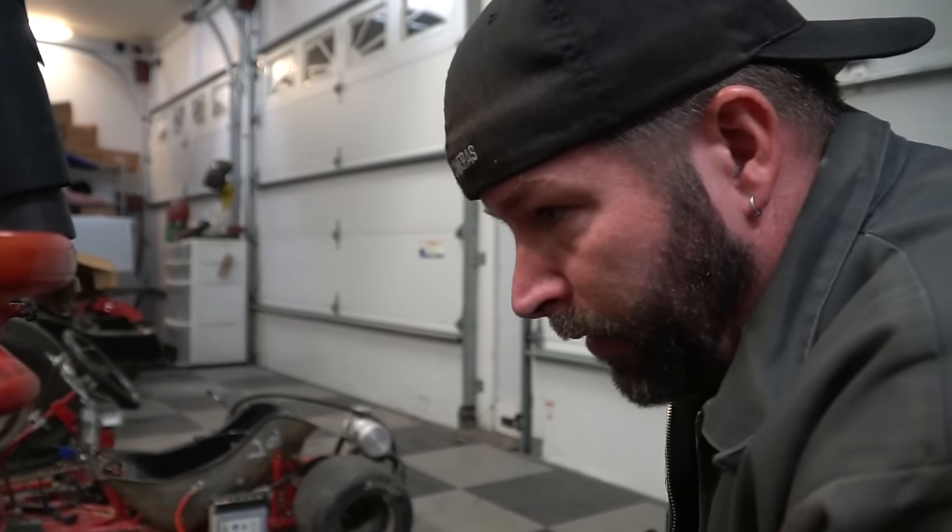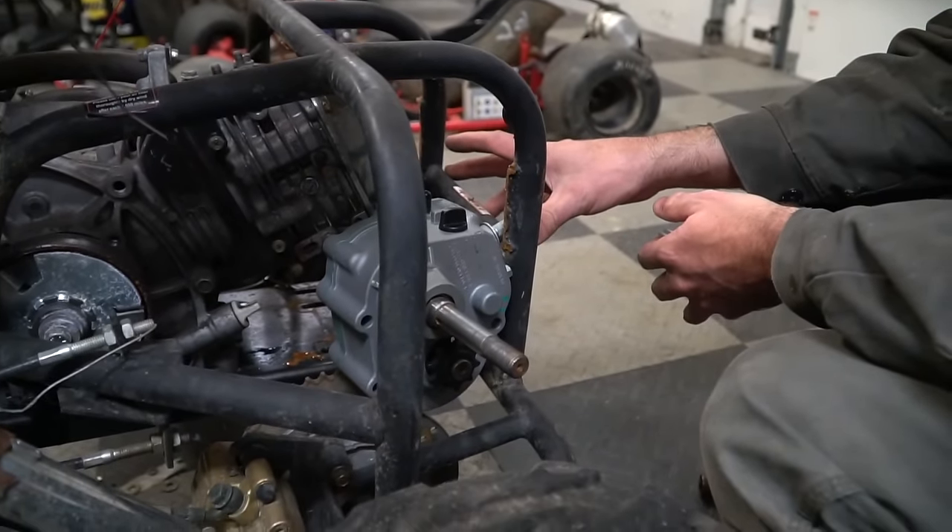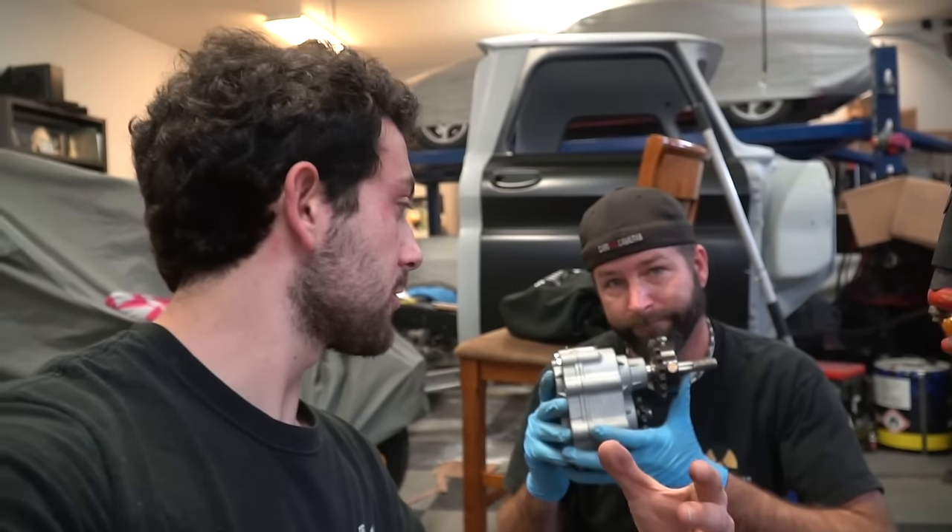As you remember in the last video with Pugly, the gearing was way, way, way too tall. We're gonna have some reduction in the reverse unit, which is nice. But we needed some reduction on top of that because we just need a lot of reduction. So we got a little creative with sprockets — we made our own custom, really really big sprocket that should reduce it by a lot. And then on top of that, because it's larger than what's designed to go on there, we're going to brace it with a pillow block bearing. When you order your reverse kit, make sure you order a gear that's going to fit your setup. This large custom one is probably not going to be for most people, but it will be for us.